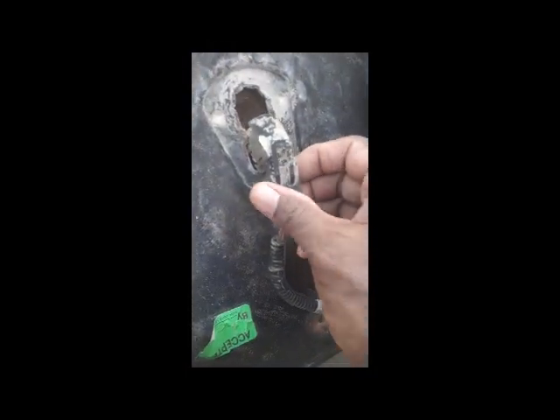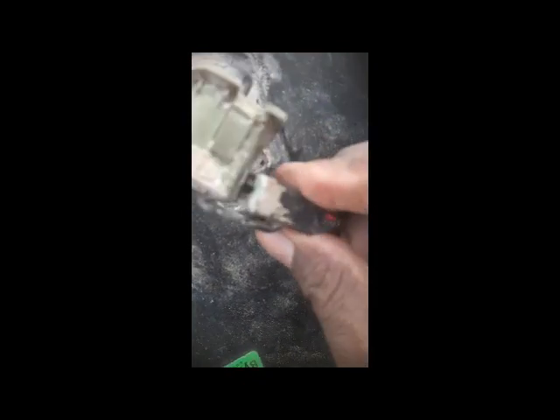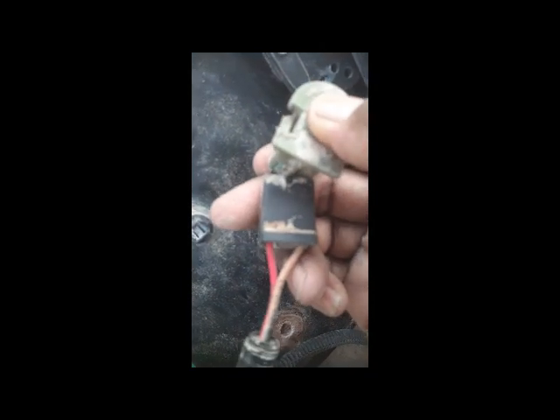As I checked, I observed — I removed this. You can see, I removed the seat. So I observed that this sensor — it has broken. You can see the wire is broken. So therefore this problem was coming, because when we sit on the seat this presses and this connector becomes on, this power goes to somewhere — so our function starts. The problem is this: this wire has broken off this sensor under the seat.